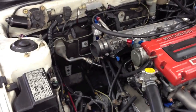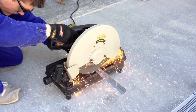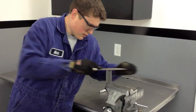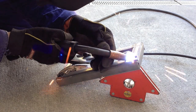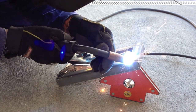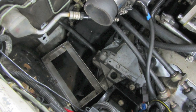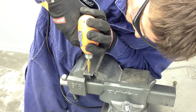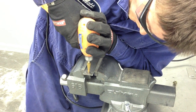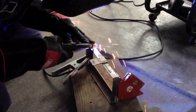Now that I have a good, strong battery, I need to find a new home for it. Once I cleared out the stock battery tray and support, I actually had a nice size spot for it. I started by building the base of the battery tray using some angle iron picked up at the hardware store. I cut the pieces I needed and filed off the rough edges. Once I had the four pieces for the base cut to fit the battery, it was time to weld them all together. After the tray was all welded together, one more test fit was needed so we could fab up some mounting brackets to attach it to the car's frame. Once the fit was right, I made some cardboard templates and then transferred that to flat stock steel, then drilled out matching mounting holes on both brackets — I love a step drill for this sort of job. After positioning the mounting brackets just right, I welded them in place.